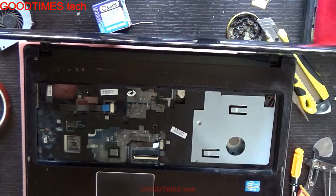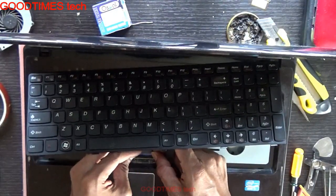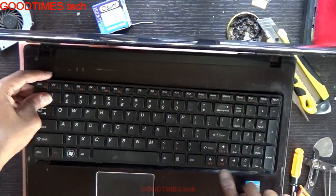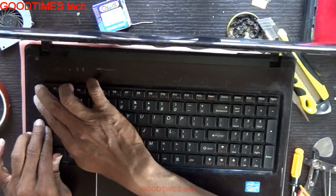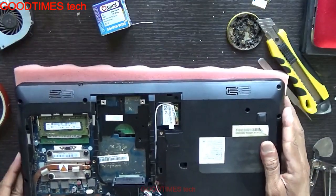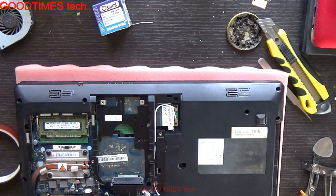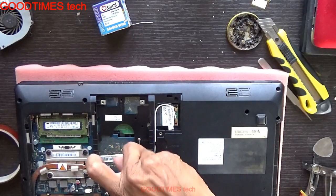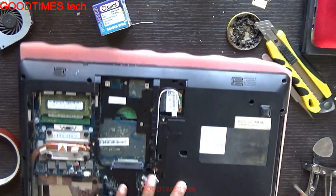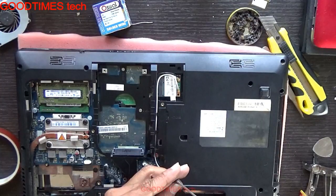Take your keyboard, make sure this white line is straight, and insert these notches into the groove. Now go ahead fastening all the screws. The two 5mm silver screws go under the hard disk. The small screws are under the DVD drive. The flat head wide-head screws all come under the battery.